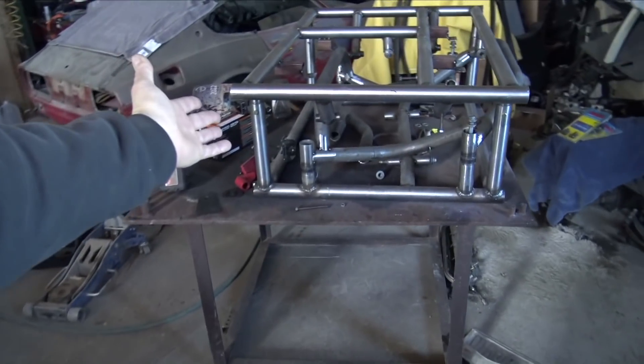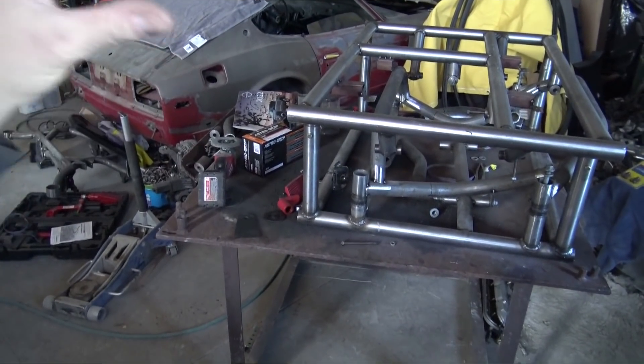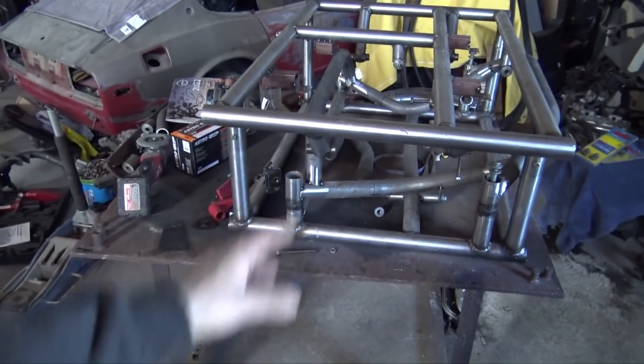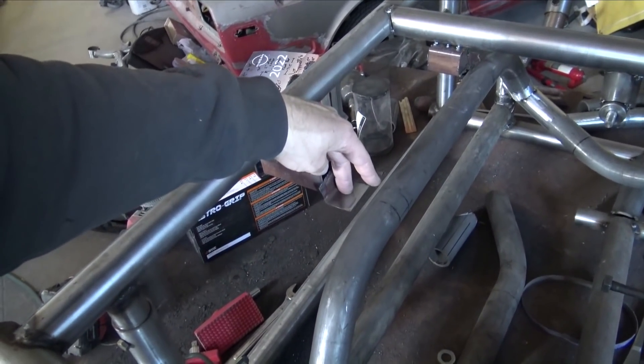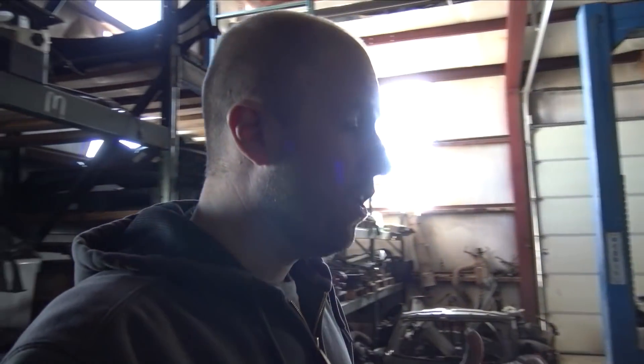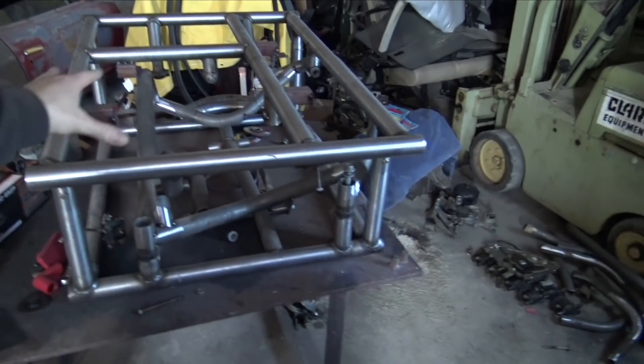The charger front subframe is coming together pretty well. I have all the mounting locations so this subframe bolts into the charger, but there are quite a few brackets that I'll need to have cut. I've made templates for most of this stuff, and I still need to make templates for the lower control arm pickup points, some of the diff mounting pickup points, the front splash shield mounting points, and I also need to retain the tow hook — there's a hole right in the center of the splash shield for it. When you have all the aerodynamic trays on challengers, chargers, trackhawks, and durangos, that's really the only place for a tow truck driver to hook a chain to pull it on a truck.